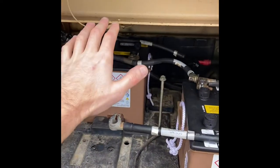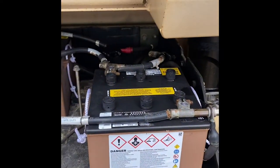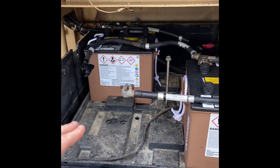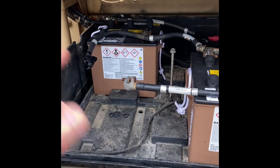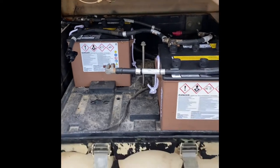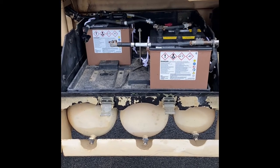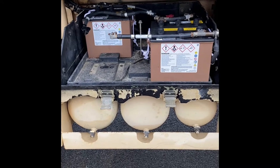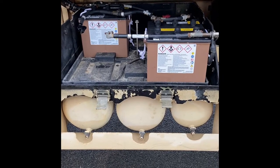I'm going to put one battery here and one battery here, so that one will be set back and I'll have space up front. I'm going to do a battery kill switch so that I can manually kill power to the rest of the truck from here — and that's going to be everything except the starter. The starter I'm going to keep hard-lined in, even with the kill switch. That's the gist of it, though it's going to take quite a bit.